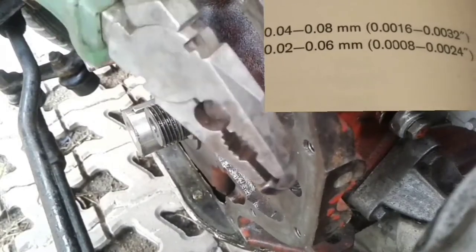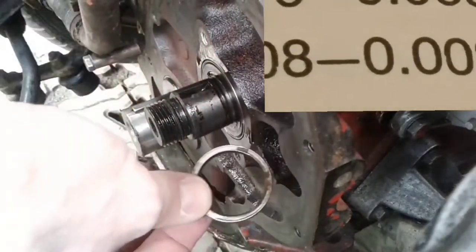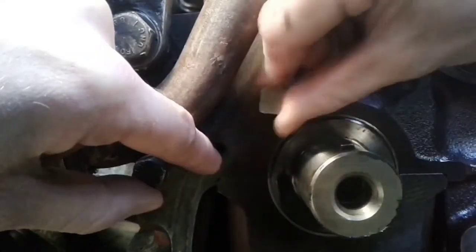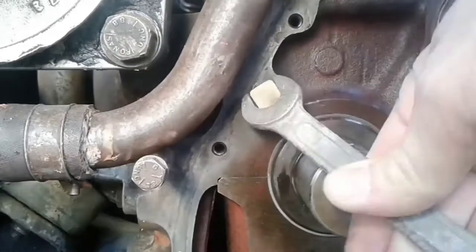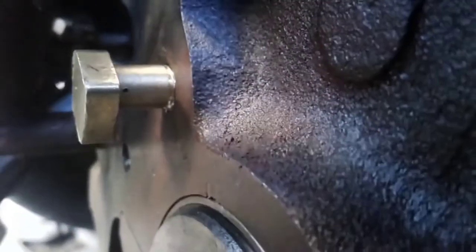But if you go that way, the amount of wear on the thrust plate is again unpredictable. I removed the spacer ring to measure the difference in thickness between the bronze plate and the spacer ring. The clean bronze oil jet must be reinstalled. When tightening it, always remember that it is a bronze part with a tapered thread. The spray of oil should be directed between the two gears.